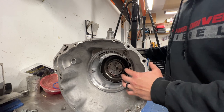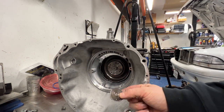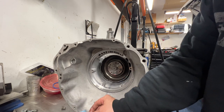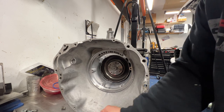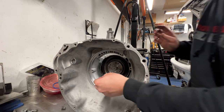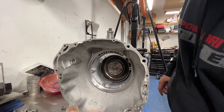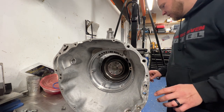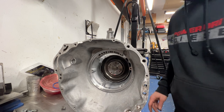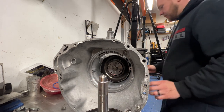Now there are some washers - there's a washer and then a thrust washer that you can get in different thicknesses, and that is to set the final end play on this transmission. So our little round washer goes here - we'll put some assembly lube on it and stick it in there. That's where it will live. Next, our drums are going to go in. We already checked the clearances in this stuff earlier. This is when the drums go into place - it's kind of not fun to do especially when you're working with the transmission on its side rather than upright.